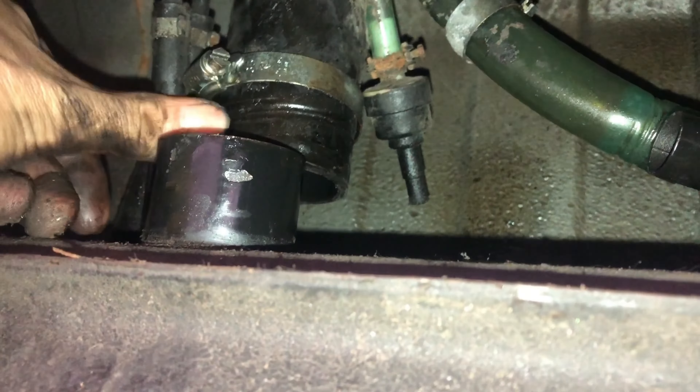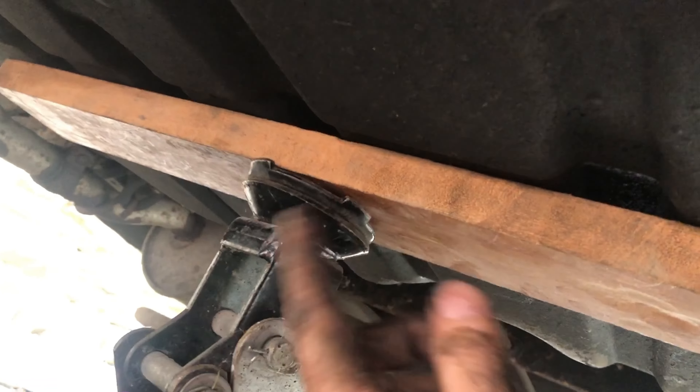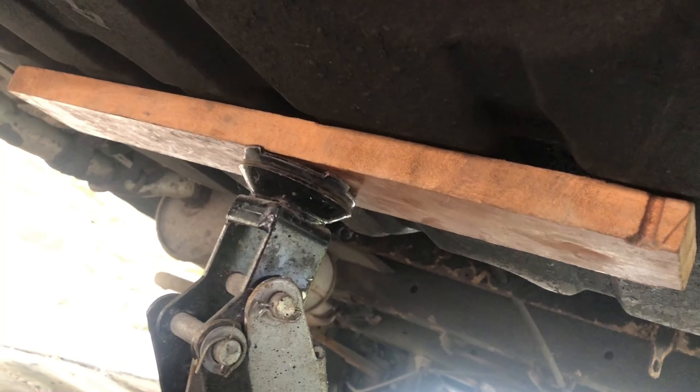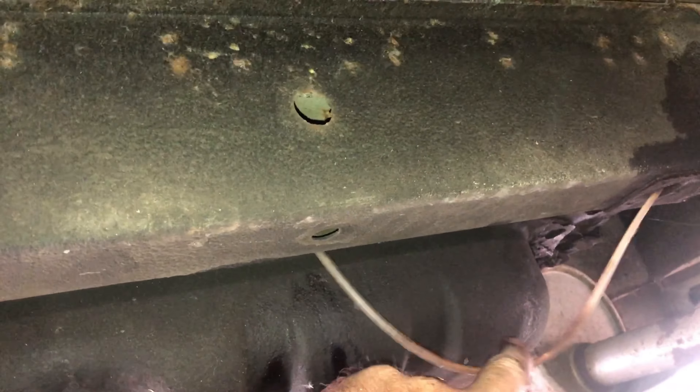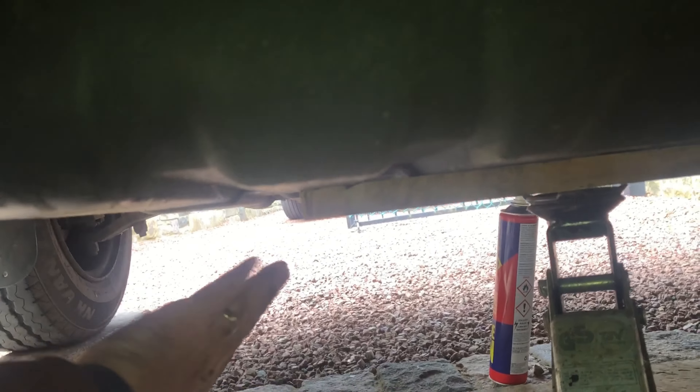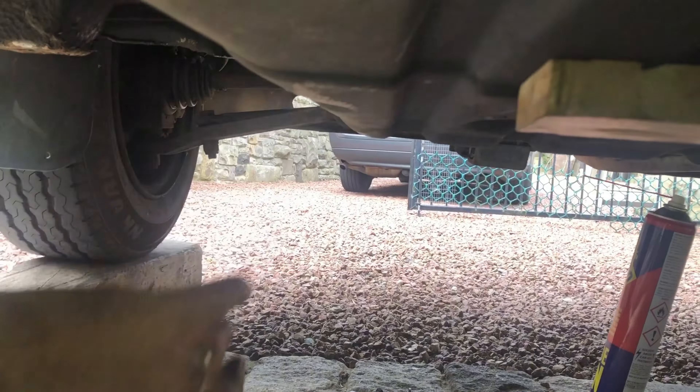On second thoughts I've decided to put a jack with a block of wood in — I just want more control over it going down; I don't want to rip any hoses off. I want to control its descent. So that's all four bolts out, and there's the pipe for the diesel heater which goes somewhere over the top of the tank — I've just unclipped it to put a bit of slack in. You can see we've got it on a jack, nearly central. There's a bit of a ridge in the tank. We'll just gently lower it in increments and keep an eye on the hoses.